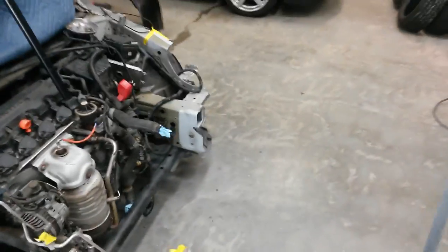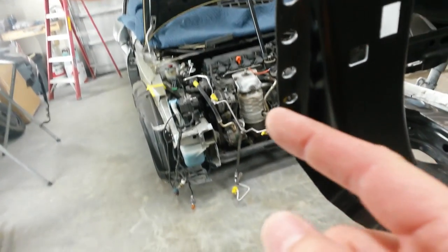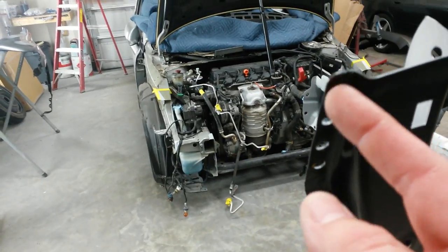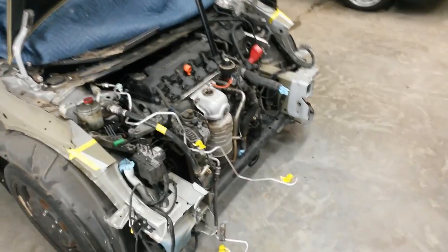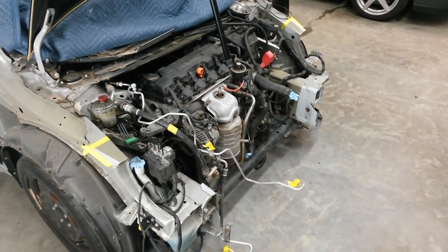And once the part's in, go back through and we'll either scratch the weld through primer off the car in this hole, or we'll just take a spot blaster and clean this out so we've got direct contact metal there to weld to. We're not welding directly on the weld through primer. I'll have that in shortly. I'll get it back in the original position and we'll start to tack it.